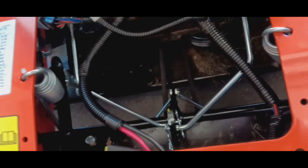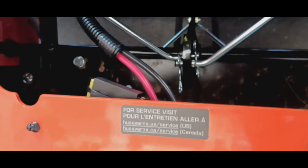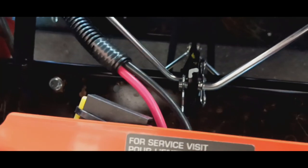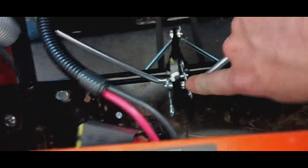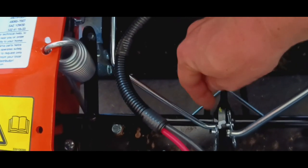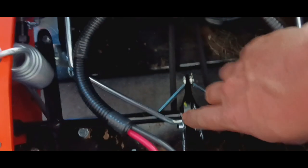Now I'm going to show you what I did with the parking brake. I'll lift the seat back and rest it on my head. This side here doesn't really do anything by itself — you have to do it on both sides. Watch — it drops. Then you bring this one back a little bit. What I did was take these two rods: this rod was down one hole and this rod was down the other hole, each in individually wrong holes. I put them where they're supposed to be, fixed it yesterday, and now it unlocks as it should.